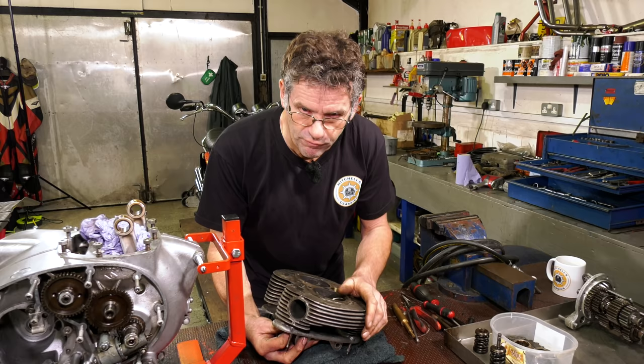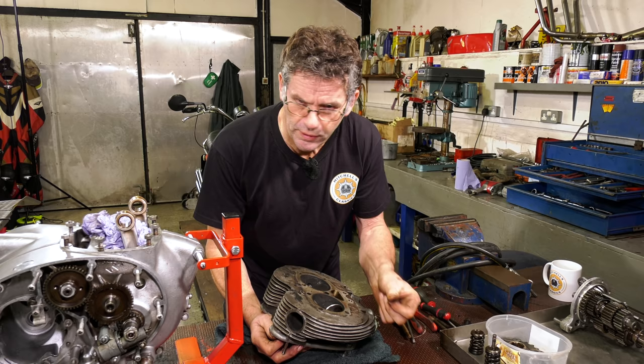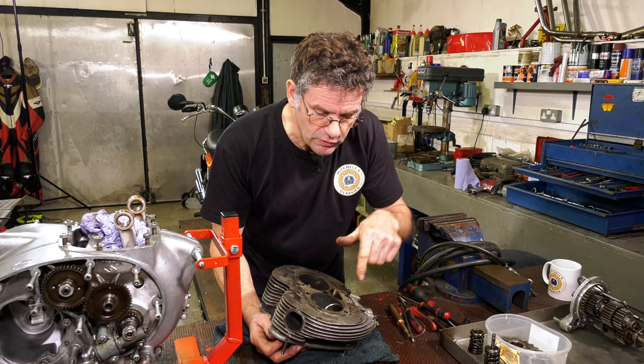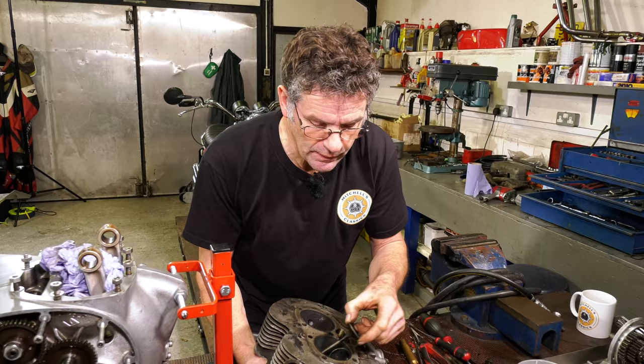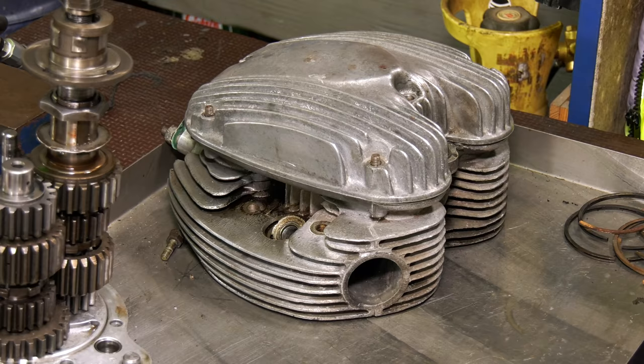It's very easy to think you've got more going on than you really have. Just look at your valve guides. Don't just take your head off - take your valve springs out, check your valve and your guide, and make sure that's good before you go any deeper really. Because what you'll find, once your head's off, you'll move the piston and think, actually there's not a lot of wear there, not a lot of movement. Get your head sorted out first. If you can't see any score marks in the barrel and there's not excessive movement, it will be oiling because it's dropped down from the valve guide. It's more likely to be all located in the top end. It's one that can get missed and it's easily rectified.